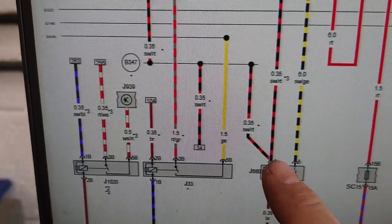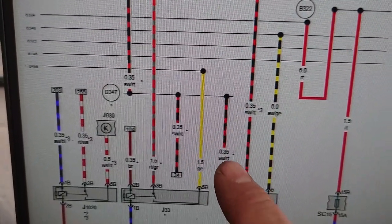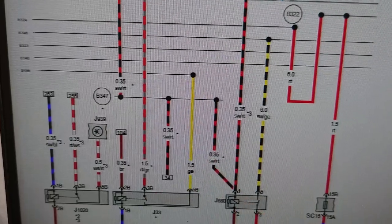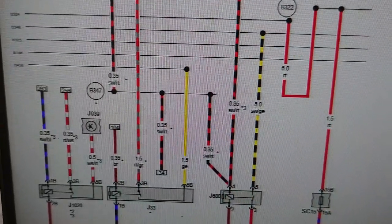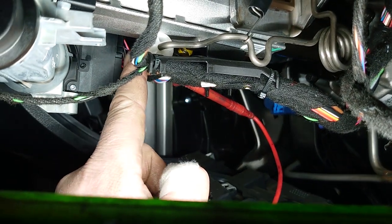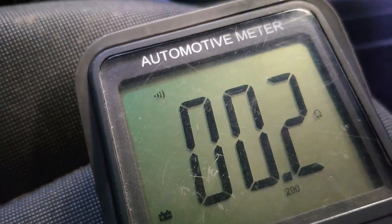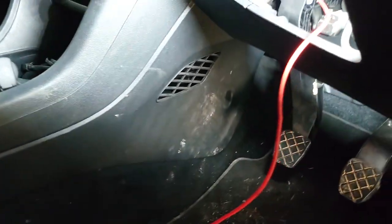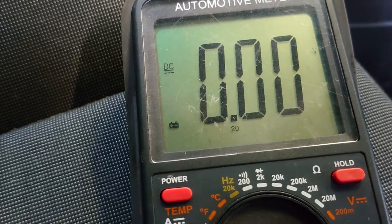So terminal one — this is the one that goes through the ignition switch. Follow the wiring diagram, that's where it goes. So if we haven't got 12 volts coming out the back of the ignition switch, the ignition switch is junk — that's our problem. We can put a live there and just confirm that, and then we're done. So I'm back-probed into the second wire down, which is the black and red on the back of the ignition switch, and we're in pin one on the relay. We have continuity there — we're beeping away. With the ignition on, we have zero volts coming out of there, which is no good.